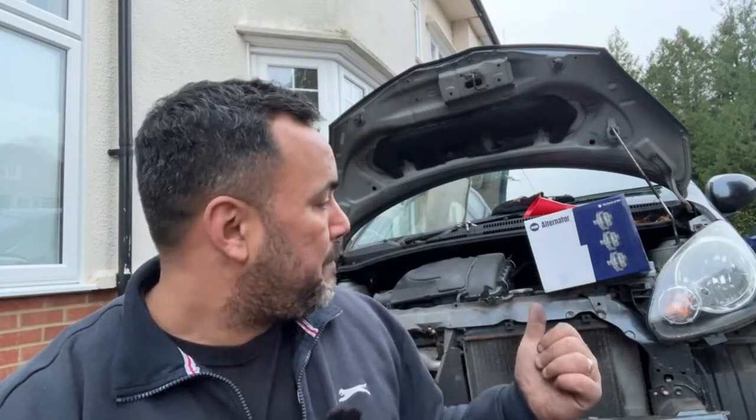So I've done all the tests with the battery. All the terminals are good, cleaned, the two connectors of the alternator as well, the same thing. I loaded the alternator, you know, put everything on, lights, heater, HVAC on and everything. And even loading the alternator, it doesn't fail now. So I know it's gonna fail because I can smell it. I smell burnt, and I know it's gonna fail again. So perhaps I'll leave the bumper off, and then I'll wait a couple of days, start the car every so often to see if it's gonna fail again. But because it's a little project, there's only a few things to do in this car. The alternator wasn't one of them. When I got the car, it was working perfectly.